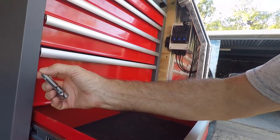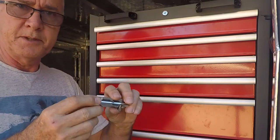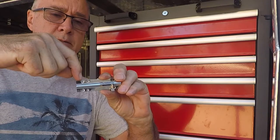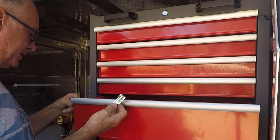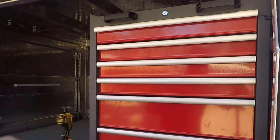The original hole drilled in here — when I try and fit that — it's going to hit this lip, which is actually the side of the drawer. So I'm going to have to redrill these holes. This row of holes is going to be redrilled a quarter inch in from where they are, otherwise they're going to foul on there. I don't want to move the pad bolt further in because it'll give me less throw into this case. The original hole was just on the inside edge, about 10mm in. I've made a new hole 20mm in, and that's going to clear the shoulder and clear this little lip on the front. I'll go ahead and mark these now and we'll drill one in and mount it.